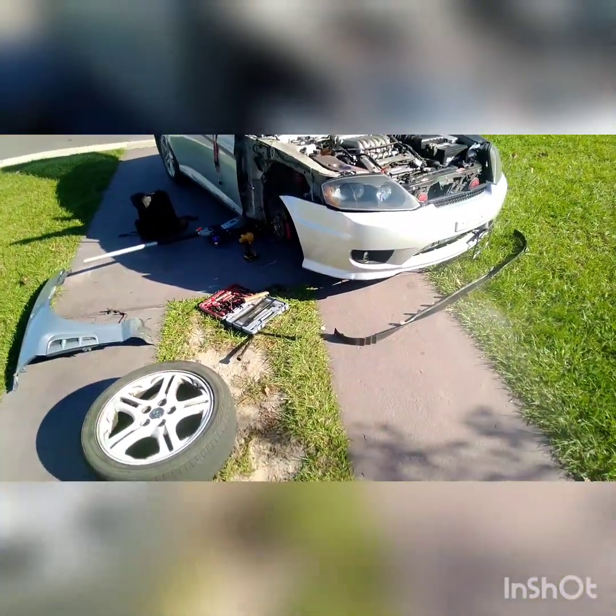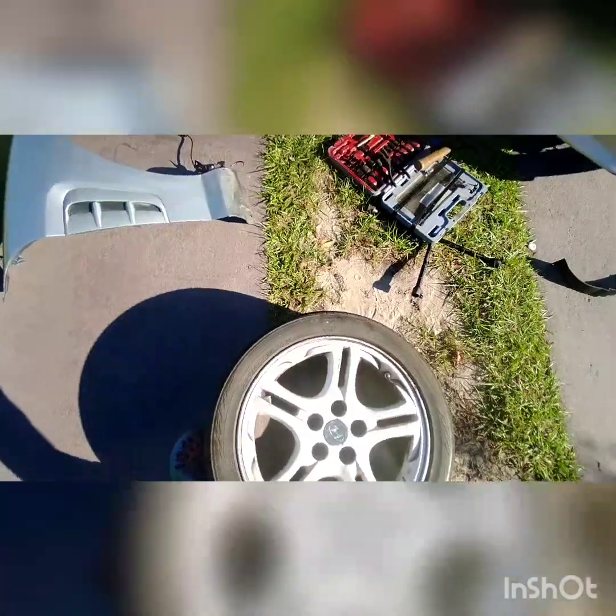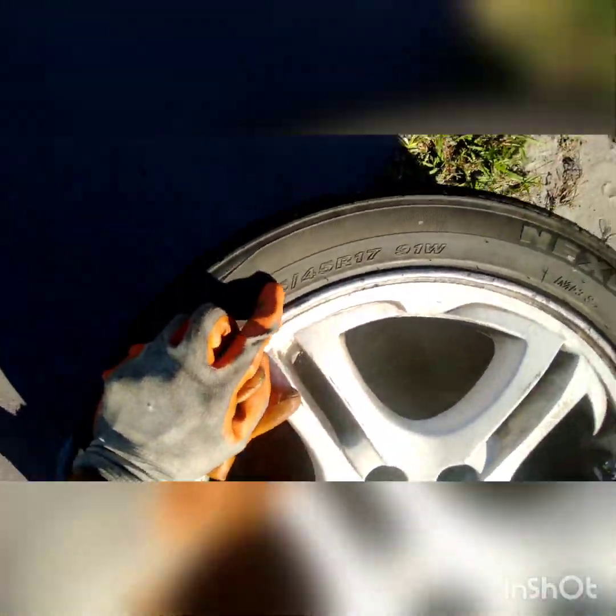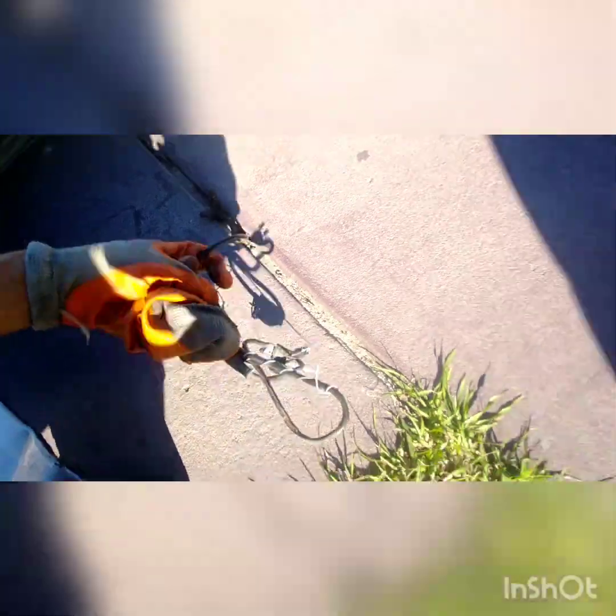If you're trying to go low and you have a 2006 Hyundai Tiburon running 225-45 R17 tires, when you go low a certain point — not even all the way low — the ABS sensor rubs a lot. If your tires are brand new, the ABS wheel speed sensor rubbing becomes a real problem.